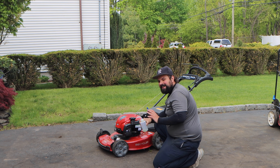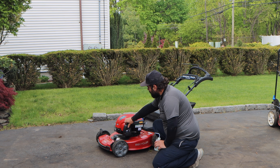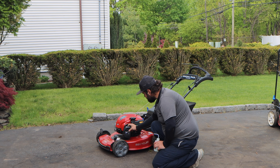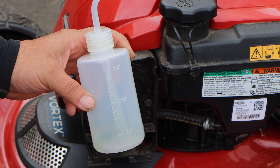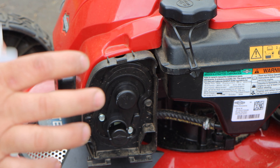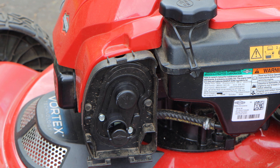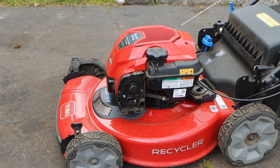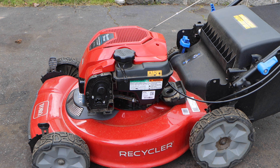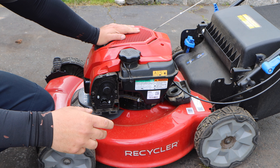So anyway, we are going to save the pain and agony of dragging out all these tools to test various components. We're going to go right for the gander — pop off the air filter cover, remove the air filter, and focus on this open hole right here. We're going to take our go-go juice, which is basically two-cycle or any stored combustible fluid, and go right into this hole. Then we're going to try and start the lawnmower. Bail cable down, give it a rip.